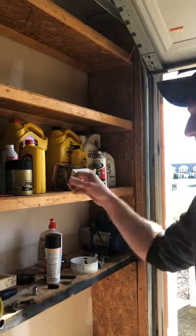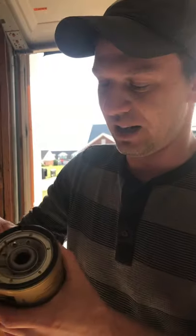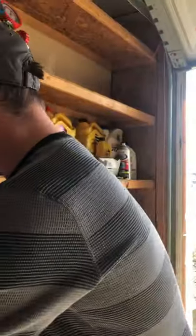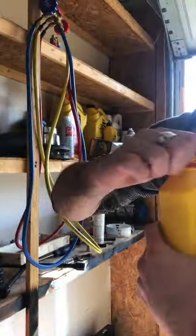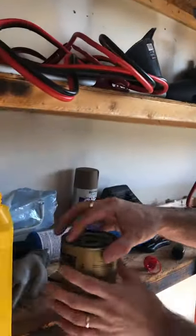I'm gonna go ahead and hand twist the filter off. I don't like this design because the oil goes everywhere — if you don't have gloves you're gonna get oil everywhere. Put that there. The reason I use cardboard is because I don't want oil on my pavement or driveway. While that's draining, I'll get the new filter set up. Clean the surface, make sure there's no debris, take a little bit of the new oil and rub it on the gasket.